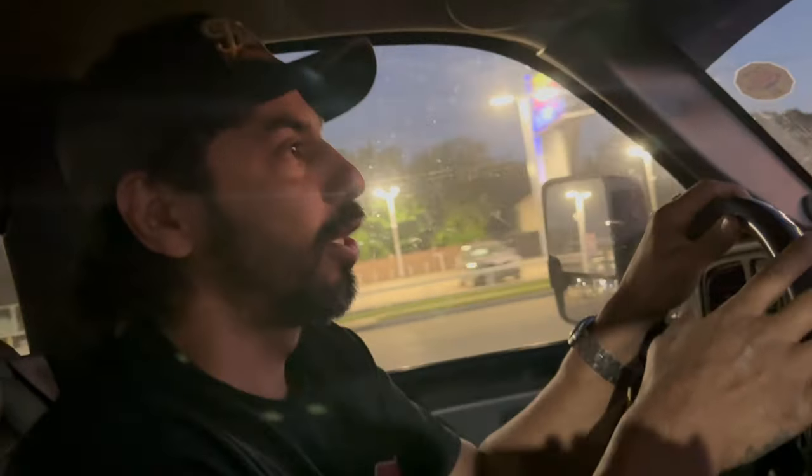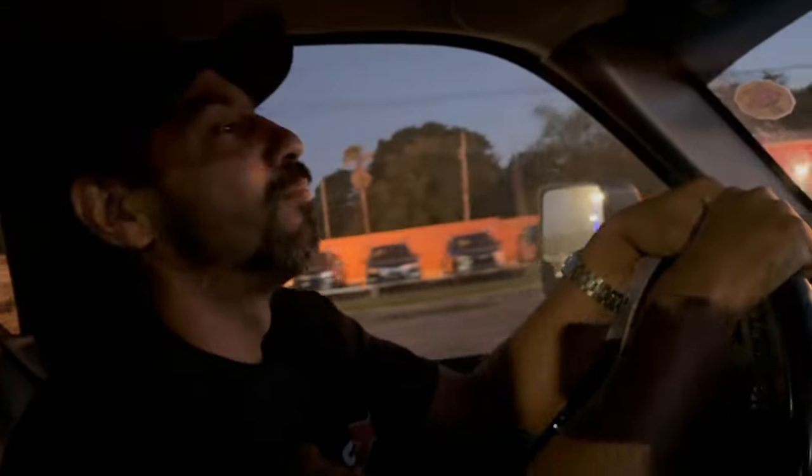You know, it's a little bitty motor. It's got like a 4200 stall already in it, but it's a little bitty motor. And with a 342 gear, it does real good, but it needs more RPM. So we went with the 430 so we can roast the tires, blow them up. We'll see what happens this weekend.